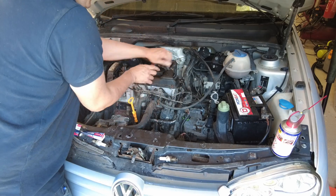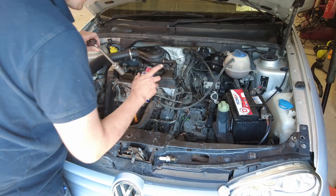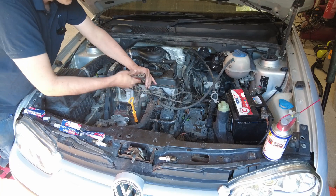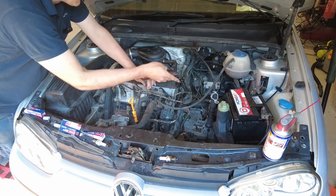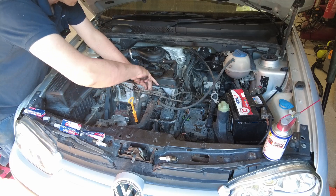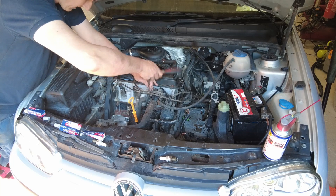Bear in mind, it's a steel spark plug into an aluminium head and you're going to get galvanic corrosion. It doesn't happen if you change the spark plugs when they're supposed to be changed. But this car has been sitting up since — well, according to the insurance disc, it's sat in 2017. That's just six years off the road. It probably had a couple of small runs since then but nothing of any great significance.